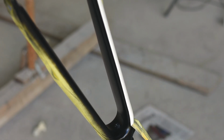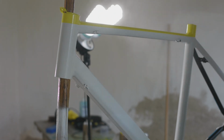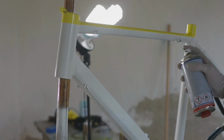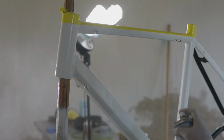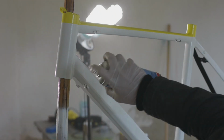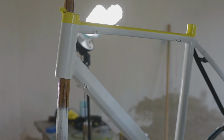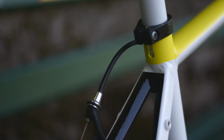But I was not done just yet, because in order to protect the paint coats from the elements and to make the colors really pop, I put on a clear coat on all my parts. It applies similar to the primer, the only difference being that it is, as the name suggests, clear, so I had a little bit of trouble actually seeing where I had already put enough clear coat as well as where there was some missing. I highly recommend using bright lights for this step, which makes seeing the lacquer a lot easier. And just like with the primer, I didn't have enough of it to make 2 coats, so I only put on 1 coat. So I guess not ideal, but good enough for me is the theme of this project.